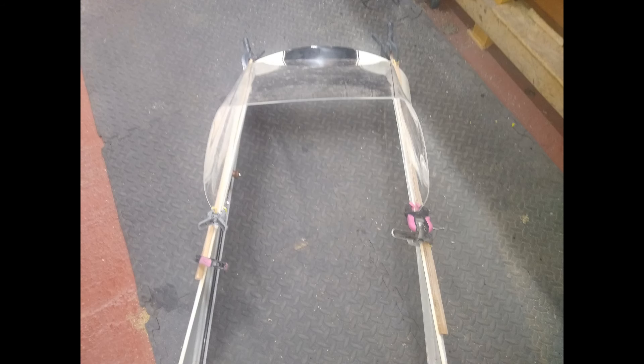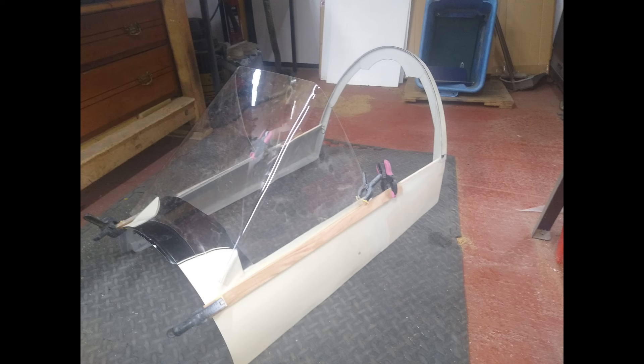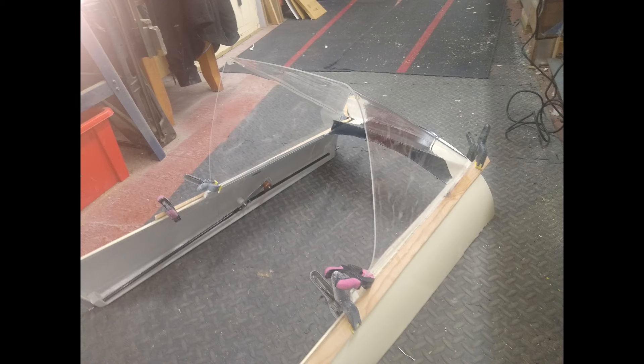As an aside, this photo shows why I haven't yet proceeded with my Spitfire look-alike sliding canopy idea. The rear part of the canopy is considerably wider than the front part and even with a few compromises it isn't going to be possible to slide the hood back very much, if at all, because the lower rail — the bit the sliding mechanism would be fixed to — would have to be equally as wide at the front as at the back. Short of redesigning the cockpit, that isn't possible without doing something strange to the front end.